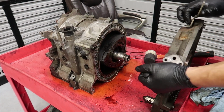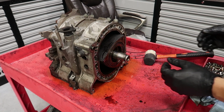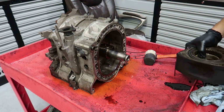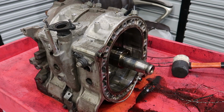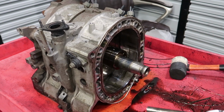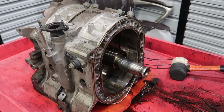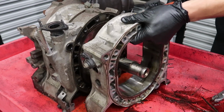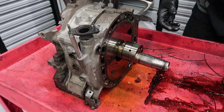Alright, this iron I definitely don't need, so I can set this apart. Now I can remove this rotor. Now I need to remove the dowel pins. Just gently grasp and pull. Now I should be able to knock this guy out too. It's one housing. Now let's see if I can get this right. I need to try to get the eccentric shaft off.